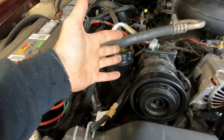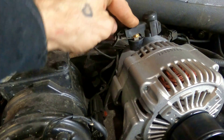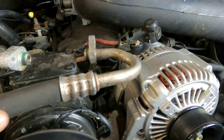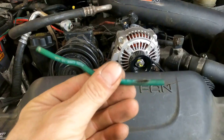What I had to do was hardwire my alternator to my power distribution box, and that's what we're here to fix today. I've been driving around like that, and should I have another situation where my alternator tries to overcharge, it will fry every single piece of circuitry and wire in there and I will be pushing this thing into the ocean. But I buried the lead a little bit here — why did all this happen? These AC tubes were running willy-nilly around the engine compartment, not my wisest move. This tube had made its way right here against the alternator, and every time I accelerated it would move back enough to ground out the entire Jeep for a split second. That would fry the internal circuitry in the alternator, causing it to overcharge, which is what blew the fusible link.